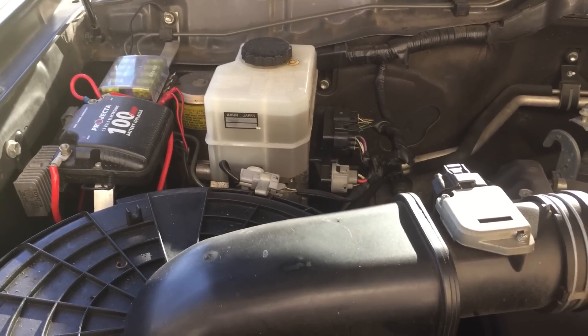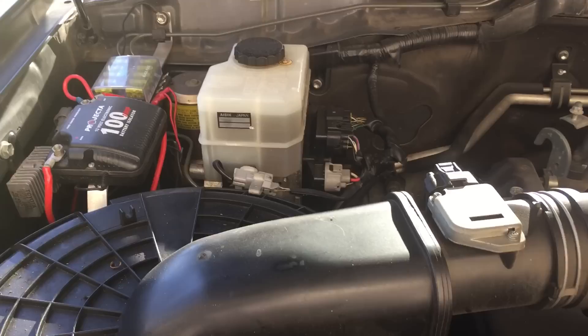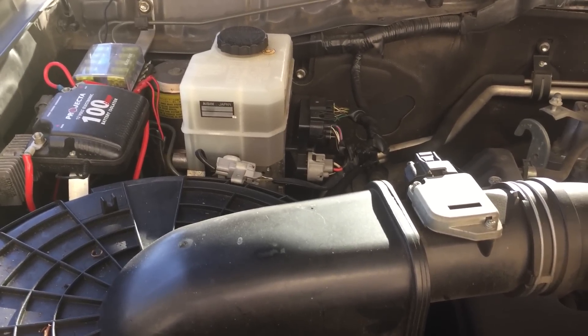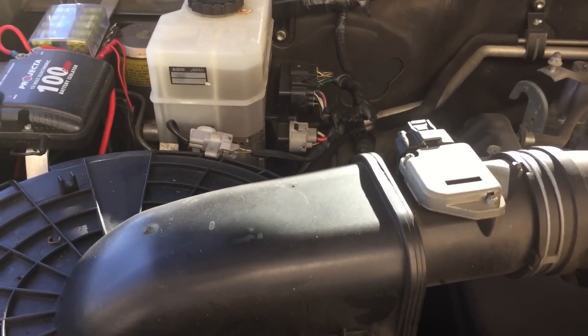The symptoms with my vehicle: I had an ABS light and buzzer come up, followed about five minutes later by practically no brakes. I put my foot on the brake pedal and it was hard as a rock — practically took two feet to stop the vehicle. I then had a diagnostic done on the computer.